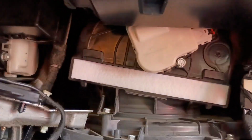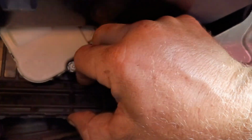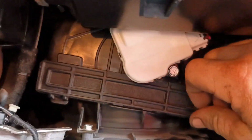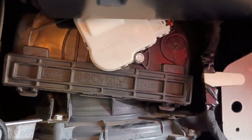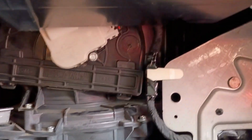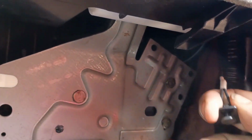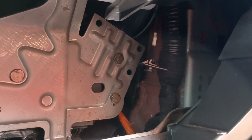We can go ahead and take the lid right here, and we're going to put the tabs in on the top, and then push it into place till you hear that click. Right, there we go. And it's nice and good to go. We can go ahead and move our glove box back into position now and reattach the glove box cord as well. The last person that was in here left it in the back for me, so I get to reinstall that. Yay!